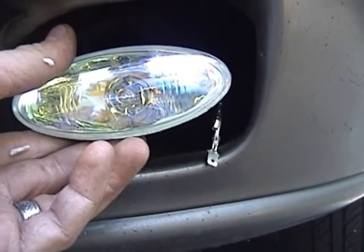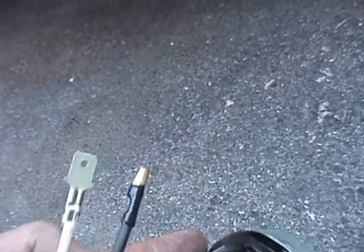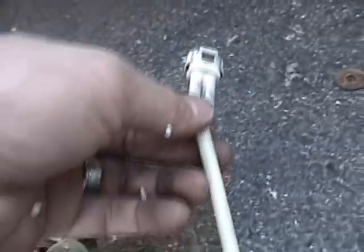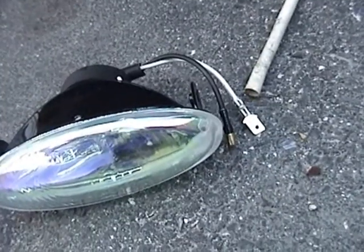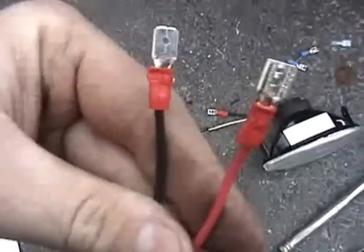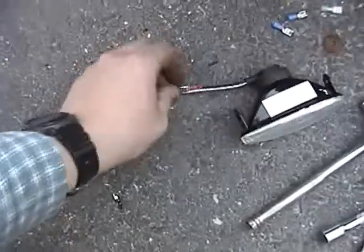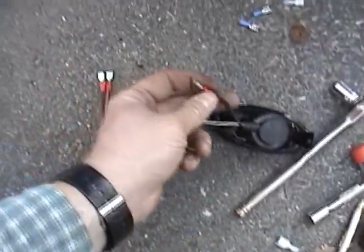Next I'm going to see if I can make this work electrically. You can see there are universal ends on these wires. I was at the junkyard earlier today and I clipped these pigtails off of some broken Subaru fog lights — one pigtail each — which will match up to the factory wiring. I want to splice this pigtail onto the new lights so I don't have to hack into the factory wiring. I've now spliced the appropriate connectors together. I did them opposite from each other so as not to be confused when I ever have to remove and reinstall this light. I also clipped off the original negative terminal on the new light and crimped on a new terminal.